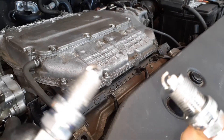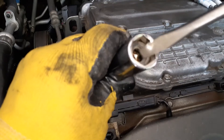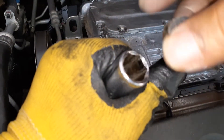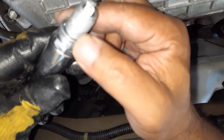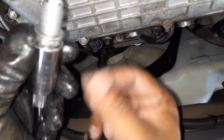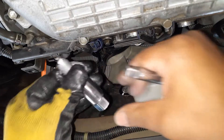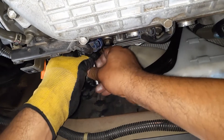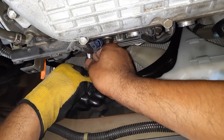One thing: you should never try to re-gap these — they came gapped from the factory, just leave it as it is. Also remember, when you are putting the spark plug back in, you want to remove the rubber gasket, because once you put the spark plug in and tighten it, this gasket will stay with the spark plug and it's very difficult to remove. I'm going to put the first one in. Just make sure there is a washer in there and drop it in slowly.